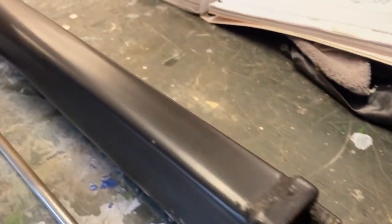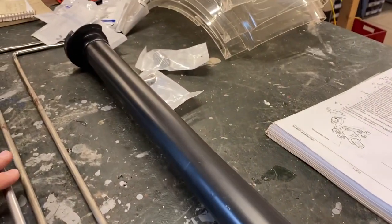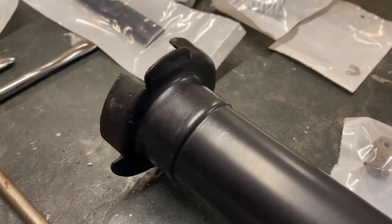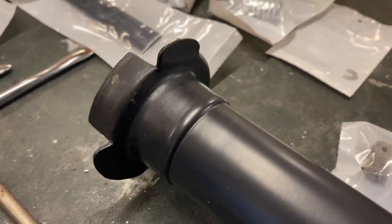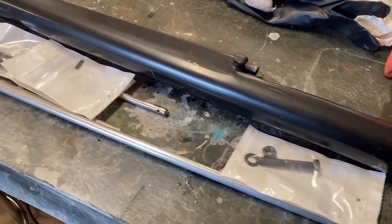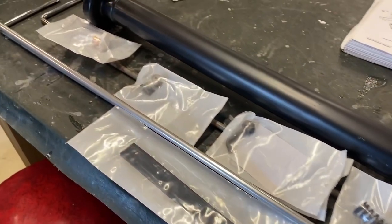The upper bushing in our two-tooth steering column is different from the 1929 to mid-1930 style ones. Those were held in place by two screws. From June of 1930 through to the end of production, the screw holes in the upper column were dropped and a V-shaped lug was added to secure the bushing. Our steering column upper bushing, while not the prettiest, seemed solid so we decided to clean it up and continue to use it.